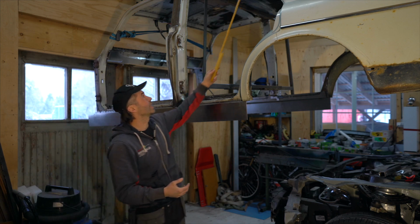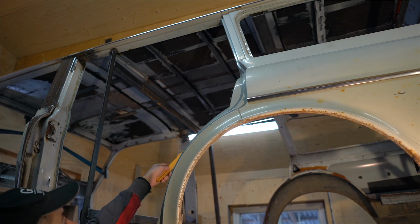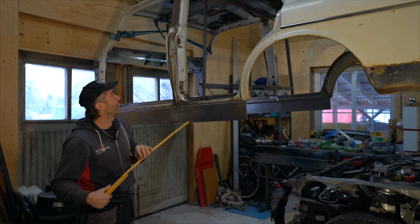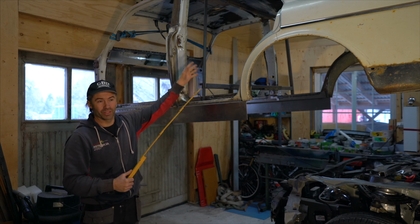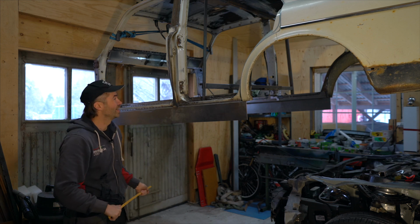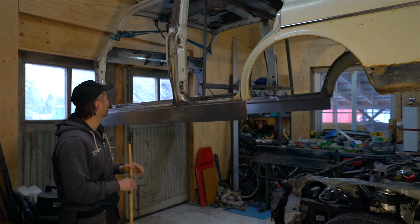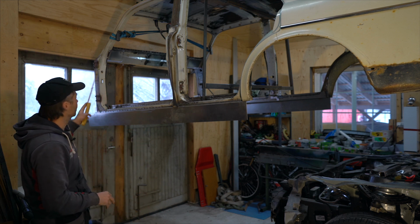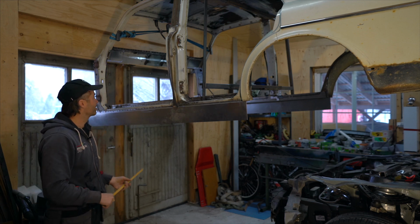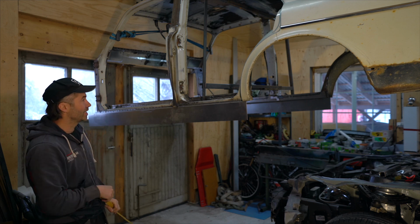Because of that, we had to create these ribs. There's 4 extra ribs in the roof. And then Magnus Prus came from Obrus Glass and actually filled it in with that windshield type glue, basically stabilized everything like a nice tight drum. So that was a big project to get the body ready. And also had to rebuild the windshield area, of course, just because when you widen it 27 centimeters, it's a lot. But anyway, that is all done and ready.